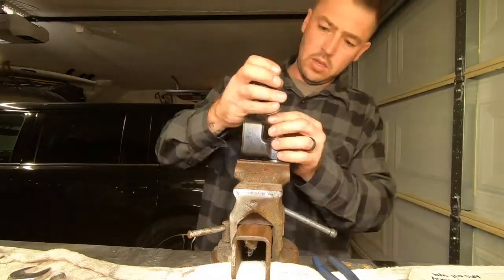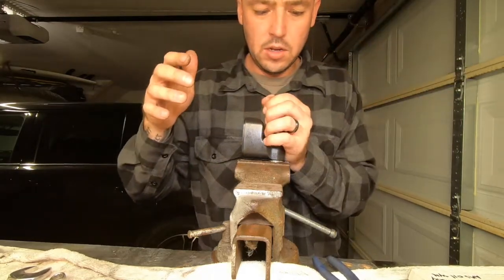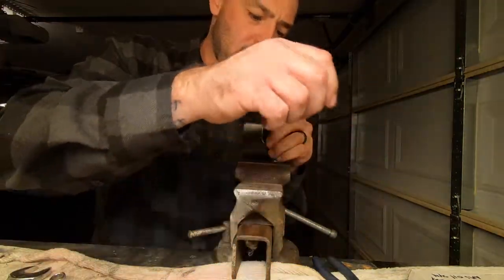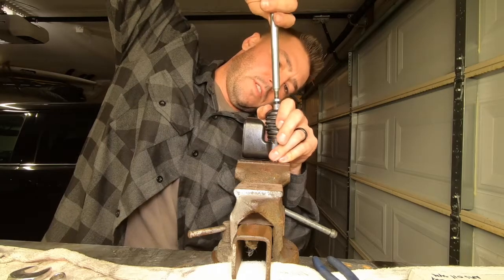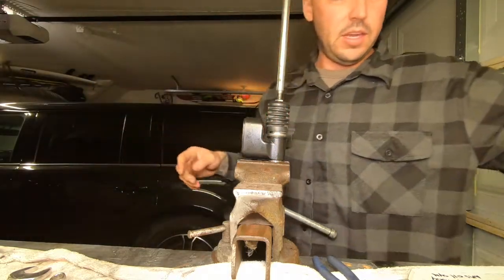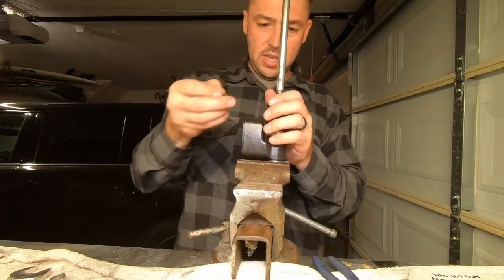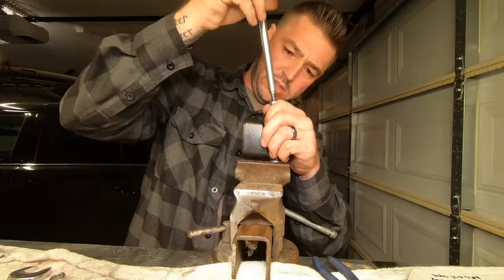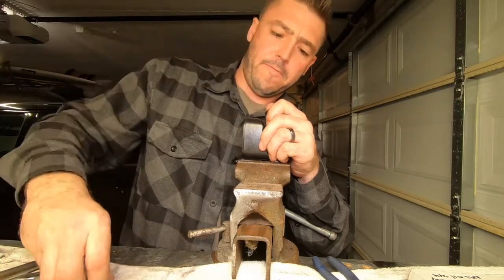This is why I have the manual. Put the dust cover on, but I'm a man that doesn't always read the manual — just pop it out right here. I have to put this snap ring on it — the fat one. Before that snap ring goes on, the washer keeps that rubber piece on because it's a really wide washer. Do not forget to put the washer in like I did.